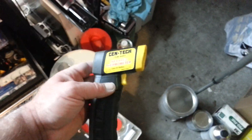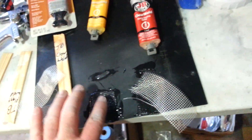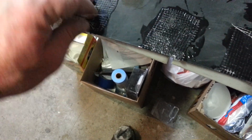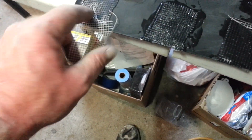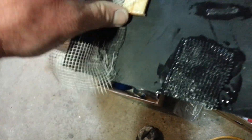When I used my infrared thermogun, the Permatex actually got up to about 96 degrees, where these only reached about 80. And you can see these are actually a little bit thicker — more product than I used on this one — so this one shouldn't have stuck as well, but it actually welded itself to the plastic.